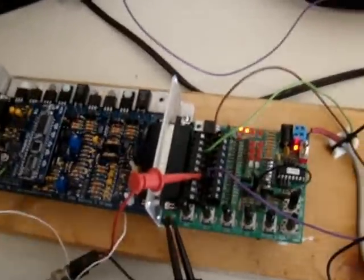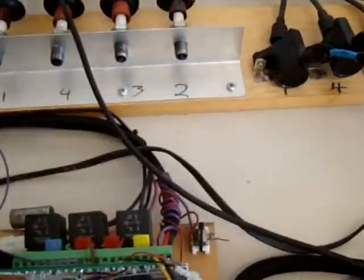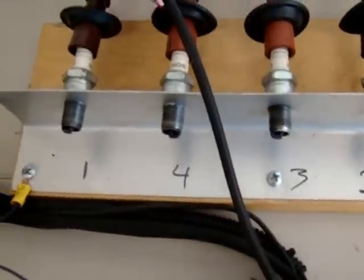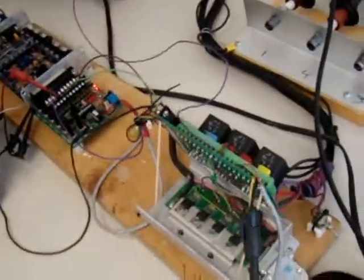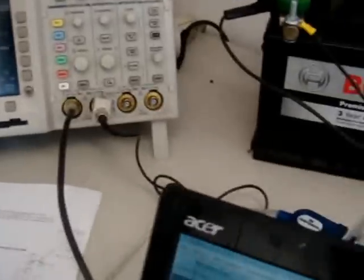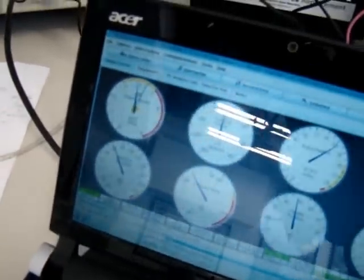Let's see if I apply some voltage to the coils — we can see that they are actually firing and everything seems to be working. I have one and three firing together, and four and two. I don't know if that's the firing order; I haven't figured out a lot of things yet. The tuner studio over here seems to be working as it should. I can vary the frequency of the oscillator — you can see the volt swings here, and the tach is just following, as well as the tach here on the tuner studio.